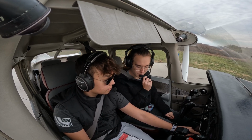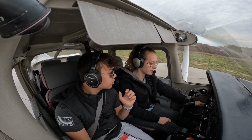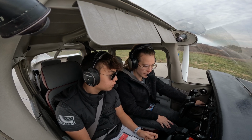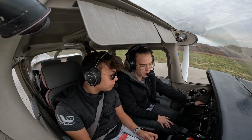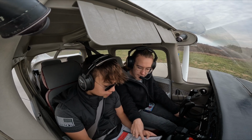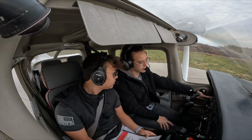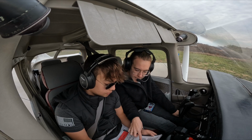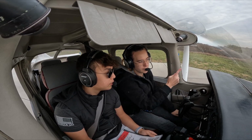Good. All right, now we're going to do the mag check, okay? Okay. So I'm going to go to right first, and then you're going to watch this and see it drop. Okay. About 50. Yep. And then we're going to go back to both, and we want to see it go back up, and it did. We'll go to left. Yep. About 75. We're going to go back to both. That was good, and we check. It says 150 max and 50 differential. We're good there. Yep. Our vacuum gauge right here, it's in the green. Yep. And then our engine instruments, test them to make sure there's no annunciator. So just click that up. Yep. And they all turned off.